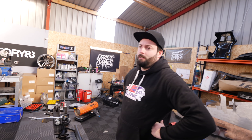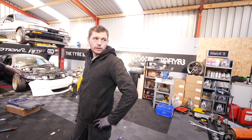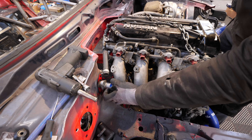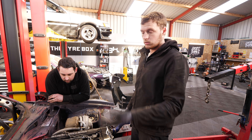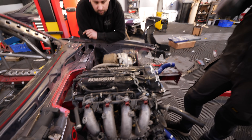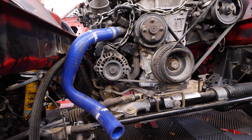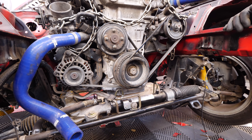What we decided is that we can get the engine in the car - we just need a clutch pedal independent of the system that's in it. We can put the clutch cylinder inside the car. It looks to me like all the rest of it fits. The inlet manifold is touching and you can't get it straight. Unless you go and buy an expensive inlet manifold - and it still might not work - we're better off just relocating the pedal. The alternator is very tight, the steering rack is an issue. But the sump fits perfect - there's almost too much clearance on the sump.